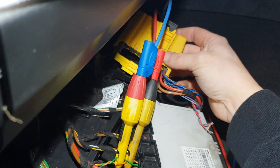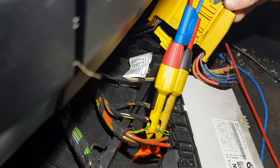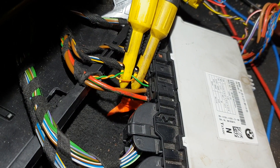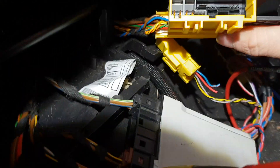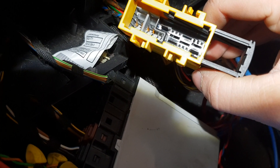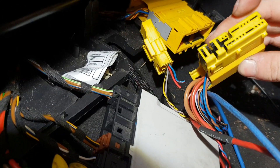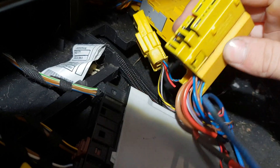I checked the wiring from the connector back here. This one back here is an interconnector only for the seat. Basically, if we can unplug it — so, these two CAN wires that operate, they basically turn the module on. They go into the pins in this connector — the top two right ones, if you can see that.